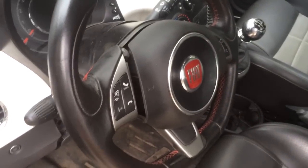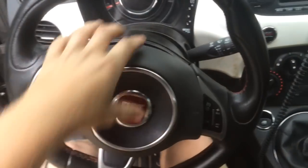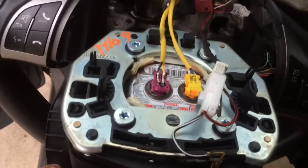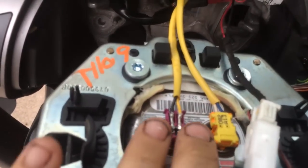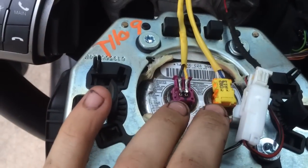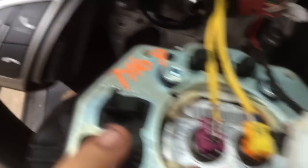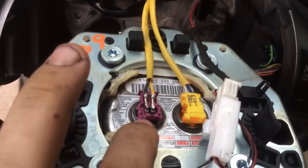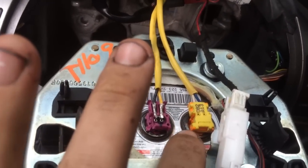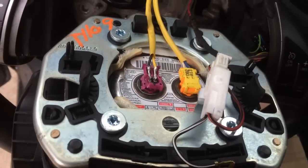Once you have released both tension clips, the airbag will be loose. Very, very carefully take the airbag forward. You'll see three plugs on the back — yours will probably be in better shape than mine. These two are the two-stage airbag connector clips. My car is a salvage vehicle, so these have already been on a deployed airbag, even though this airbag has been replaced. Take very good care — these will break easily. Take your very small standard screwdriver or pick, work these up, and pull them out. They are color-coded, so you do not need to pay mind to where they go.